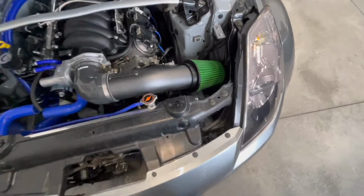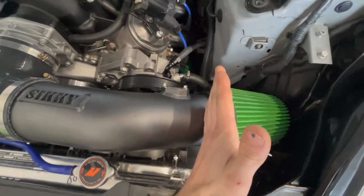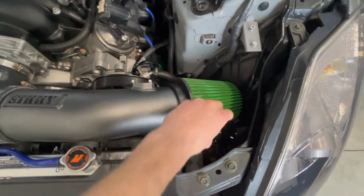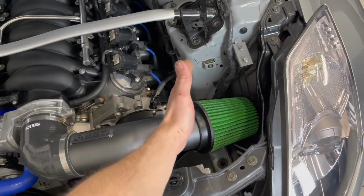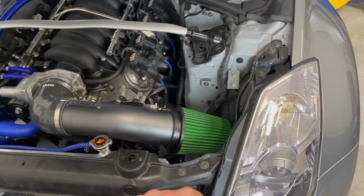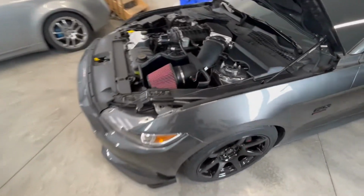Also, today I ordered a blue filter to kind of go in with everything else. The green kind of clashes with everything, but today I'm going to do a cardboard cutout here and make my own heat shield. So this whole section is kind of dedicated to cold air, and it keeps the heat away from the headers here. You know, keep as much heat down, and I'll put a nice seal along the top here, and I'll make it really nice out of aluminum. And try and seal it the best I can above here. Sort of something like this here.